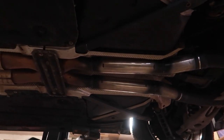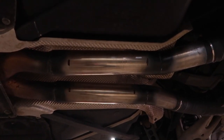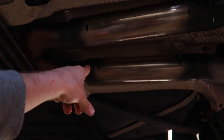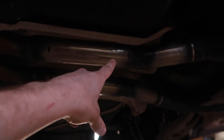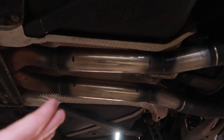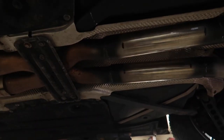The first thing I have to do in order to get these resonators installed is cut the exhaust completely in half. I'm going to cut the exhaust in half on those marks right there. I'm not going to cut those just yet — those are kind of just references. I have to do a bunch of measurements before I make a final cut on that side. But just got to make a first cut, get that back half off, and then we can go ahead and start mocking stuff up.